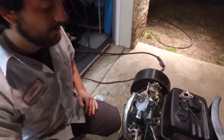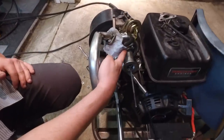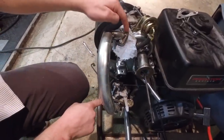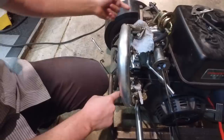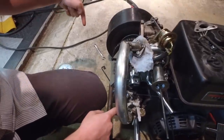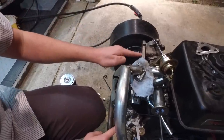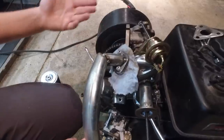Well, Jackie explains the anatomy of a turbocharger, because she remembers, because we explained it to her not too long ago. Something about fans. Yeah. Got little fans in there making magic. So this particular turbo works with air going in there from the atmosphere, and then going into the carburetor from this part of the turbo. Exhaust goes from this port to the atmosphere, and then from the exhaust in the engine to this port in the turbo, like that, and that's what Ike just finished welding.